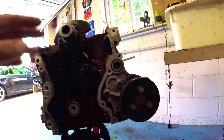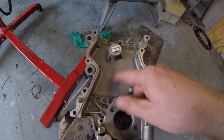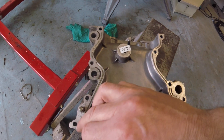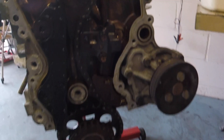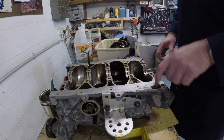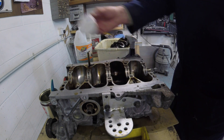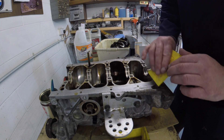The inside of the engine is absolutely filthy. The timing cover was in the same state — quite dirty — and what I've used is a combination of degreaser to get the initial grease off, then brake and clutch cleaner. I've also carefully removed the silicone sealant from the rebate here and added a couple of labels just to remind me about the seals on the block, as it's such an easy thing to forget when reassembling. On the face where the sump sealed, I used a silicone remover — normally for domestic use — which worked really well. Once it's done its job it bubbles up, and then you just use a plastic scraper to scrape off the surfaces.